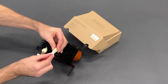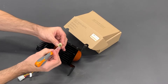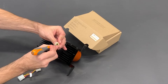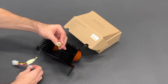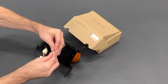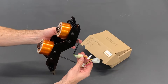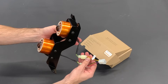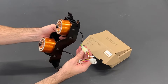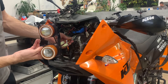Let's test the other one — too much force, so again take a small screwdriver and bend the pin a little bit upwards. Now the headlight unit is completed, but please double check that the high beam extension is connected to the lamp with the shorter tube, which is high beam. Don't forget first to plug in the headlight connector.